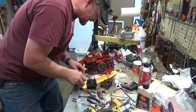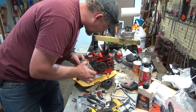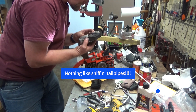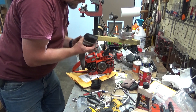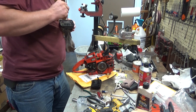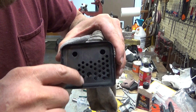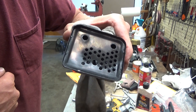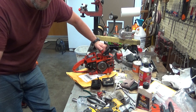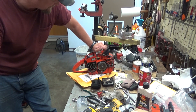I think that's actually the smell of the fuel mix. The whole muffler smells that way, and I don't see any unusual deposits. This baffle — looks like it's crimped in place, but there's not a whole bunch of deposits in here. Obviously they'd be on the backside, but you can see there's just not that much going on in there. I think I will shut the video down again, drain this True Fuel out, and put some of my Amsoil in and see if the smell changes.